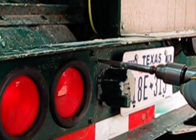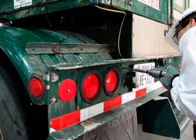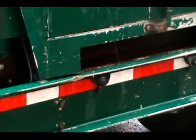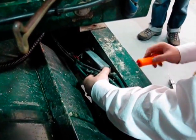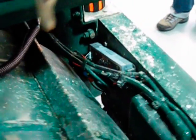The P6000 sensor system and cab display should already be installed in your vehicle. Although the installation is of no concern to you, being aware of what's installed in your vehicle is important. You will notice four aluminum alloy sensors located on the rear of the trailer body. These sensors will send out the ultrasonic waves to detect what's located up to 30 feet beyond the trailer's body. The four sensors are connected to an aluminum and steel cased brain that contains a central processing motherboard unit which gathers information from the sensors and translates it into readable information for the driver.